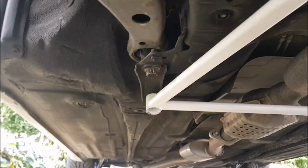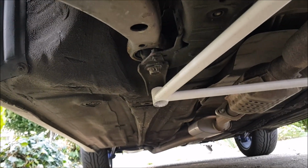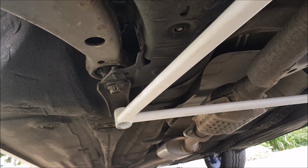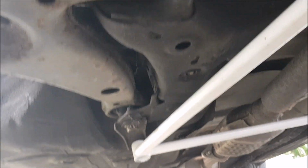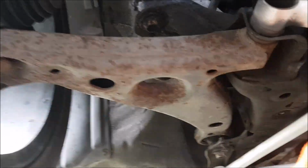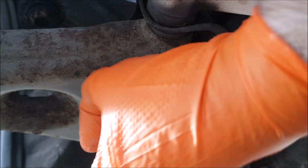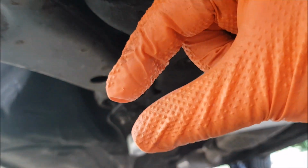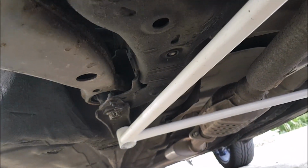As I explained in an earlier video, the rear holes didn't actually line up that much. They're only about 3/4 of a centimetre out, but having undone the mounts up here, just to see if we could push the front cross member and lower control arms or wishbones further back, because we only had to move it like that much to get it in a line. It wouldn't budge.